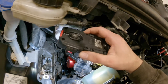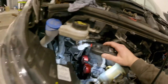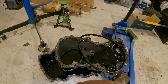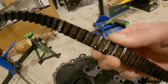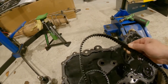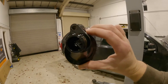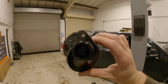Last thing I wanted to do was fit a vacuum pump and then two weeks, two months, six months down the line have the same issue again. So I removed the vehicle's sump and as you can see we've got the main timing belt, and then another belt that runs the oil pump. You can see all the rubber deteriorating on the actual timing belt itself, and then on the oil pickup filter you can see all the rubber from the belt in there, restricting the oil flow around the engine.